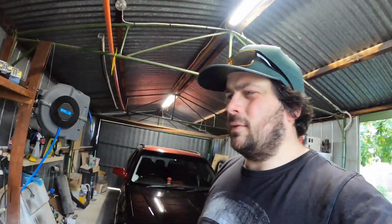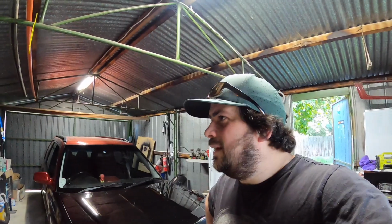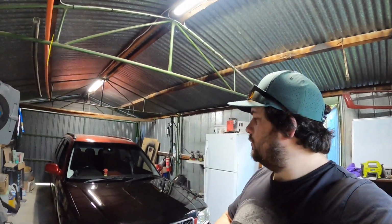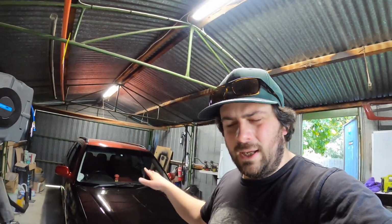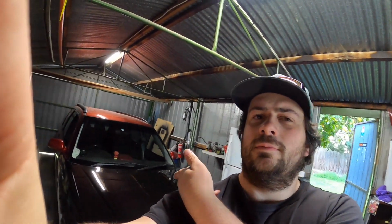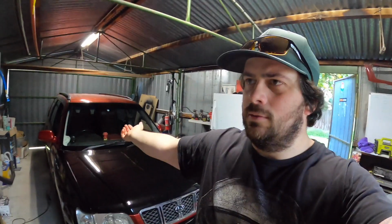That was strange. Top end didn't really change, even though I changed it by 7.5 degrees. No, 7.5%. It is running a bit richer in the upper part, which at the moment I don't really care. I'm not too fussed. It could be the timing making that happen, but yeah, hitting the 95 duty cycle, and the ECU says about 17 psi. The gauge says 20.5, but I need to get those injectors in, so let's do it.